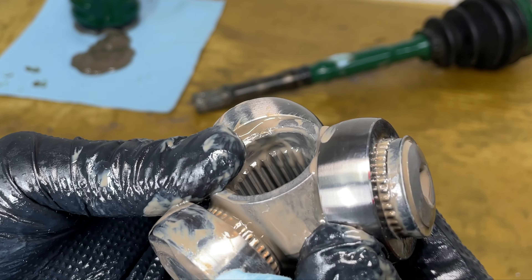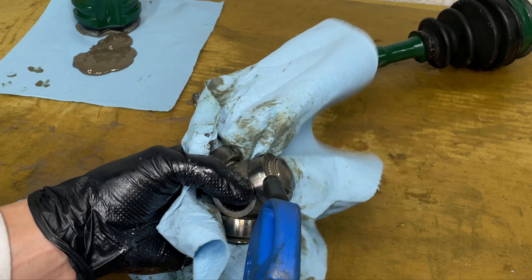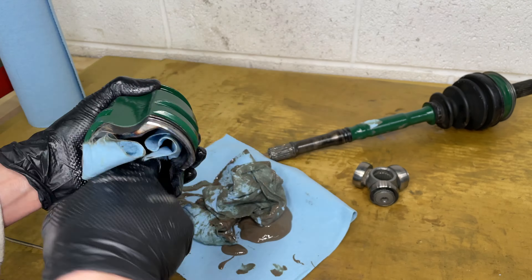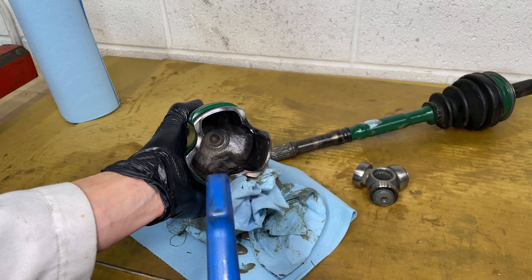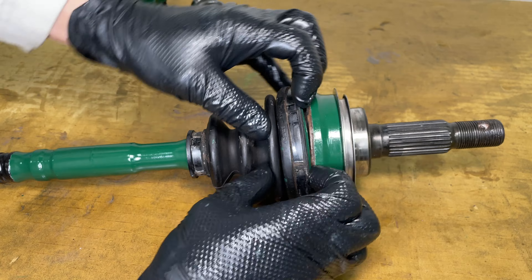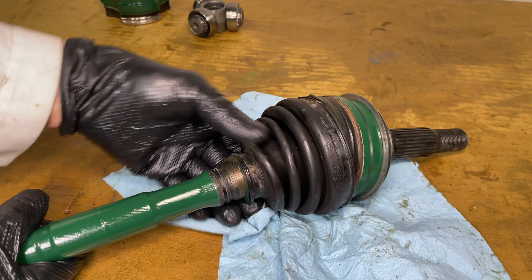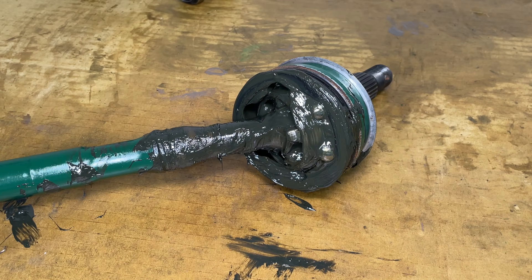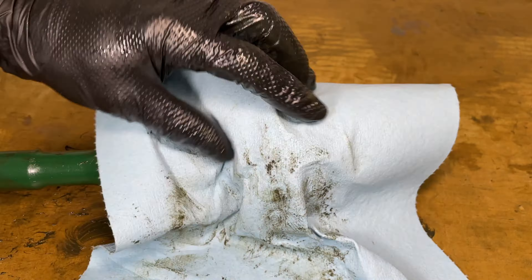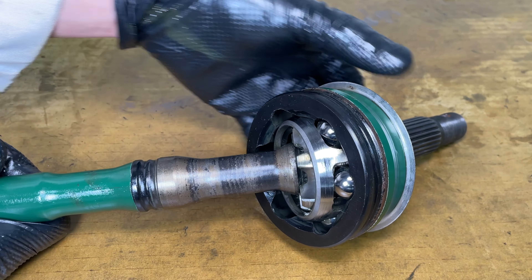These wheels are also in excellent condition — I don't see any scuffing or scratches. Use compressed air to get the grease out of the needle bearings and be careful not to make a mess. Now I'll get the old grease out of the tulip — see, this one actually looks like a tulip. Let's inspect the inside — it looks good. Moving on to the outer CV joint, pry the big side of the boot off then push the small side in. A little grease will get under the rubber and it will help you pull the boot off. The front outer CV joint is exactly the same as the rear outer CV joint. Wipe as much grease off as you can and carefully use compressed air to get the old grease out.